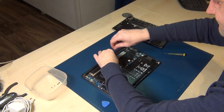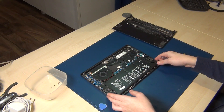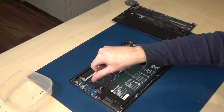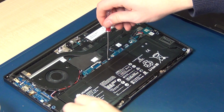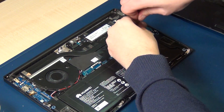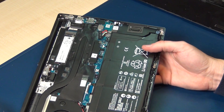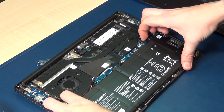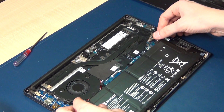It's also easy to remove the battery. Remove these three screws — zoom in a bit. One is a normal screw, and one here is under the warranty sticker, so be very careful.